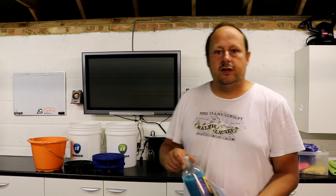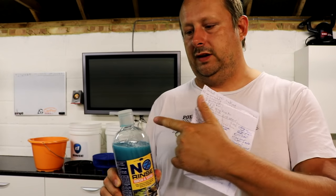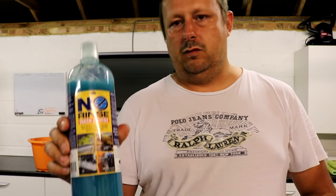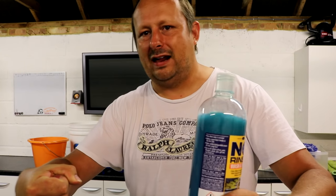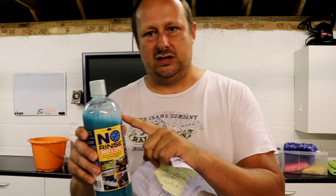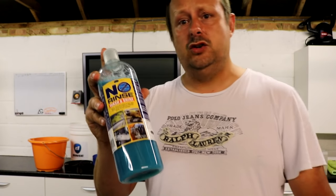Something I've only just put in the mix about a week ago: using about a quarter of a capful of Optimum No Rinse (ONR) in the bucket — about a quarter capful to five litres. I love what this does to water. It almost thins the water out and gives it this real glistening quality — almost like wrapping water in shining cling film. It's hard to explain, but you can see something happening on the clear coat and you notice the slip. It's optional, but I would have this in your arsenal because it's such a versatile product. You can get it from cleanyourcar.com.